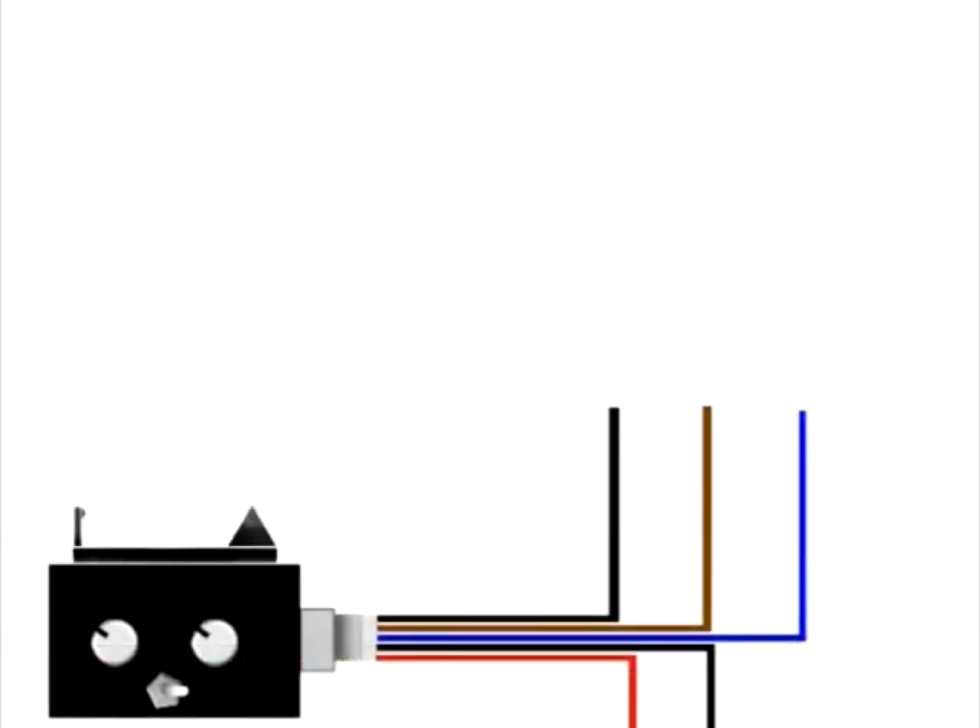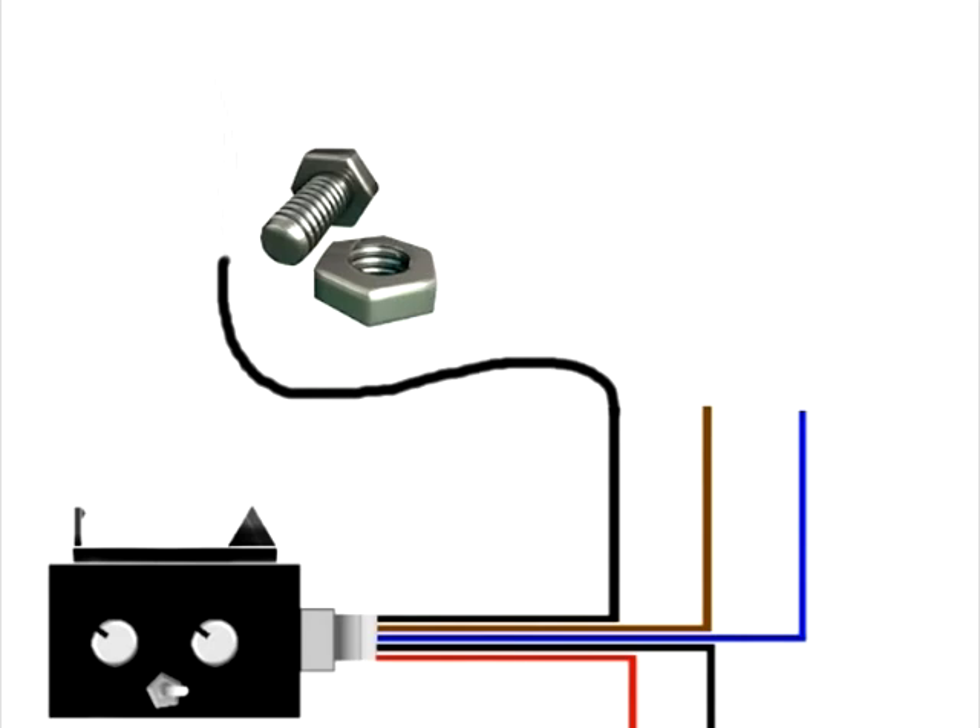Now that we have the lighting system hooked up, we'll talk about the three wires that are left over on the brake lamp module. The remaining black wire we are going to ground to the chassis of the vehicle. This step is very important — if you do not get a secure ground, the lighting will never work on the product. Please refer to the model specific instructions to locate the grounding point on your vehicle. You may want to strip the wire two to three inches so that you can wrap it around the grounding bolt and get a very good connection before you tighten it down.